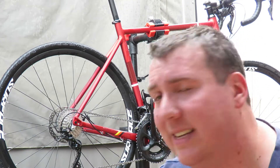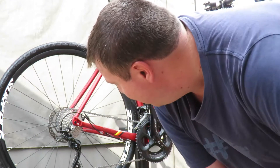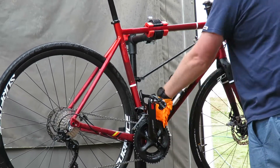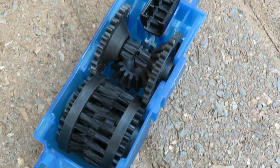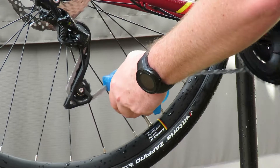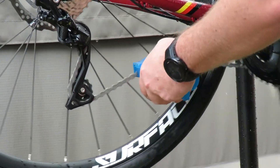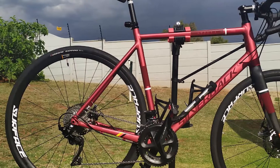Also just do your best not to touch the disc brakes too much if you've got disc brakes, because any sort of chemicals can ruin the pads — but I generally wash it down straight away and haven't really had any issues. Then I scrub everything down with the orange microfiber cloth. After that I just hose everything down with the garden hose again. The last thing I do is clean the chain with the plastic chain cleaner — some degreaser and water in there, just turning the pedals to run the chain through a couple of times, maybe for two minutes to get it nice and clean.